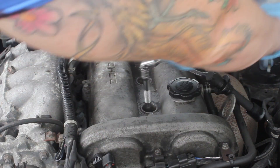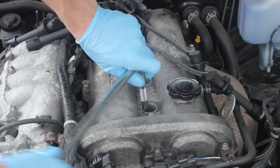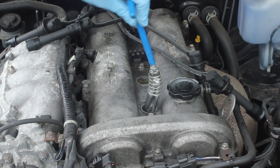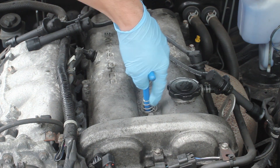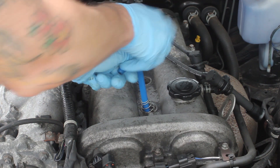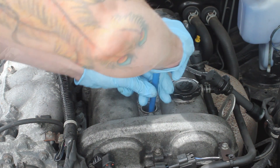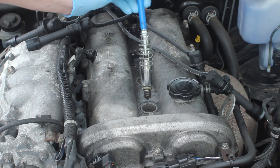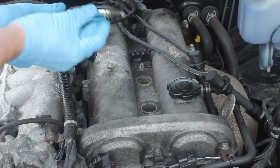You can still find diagrams online if you forget what order they go in, but we're just going to get them neatly tucked out of the way. We then get the socket on the breaker bar and crack them loose — that's been done off camera mainly, but you can see it undoes nicely. Then once that's done we can use a special spark plug tool to undo them nice and quickly — this fits in and lets you turn it by hand very quickly. We're going to pull the first spark plug and then do the other four as well.